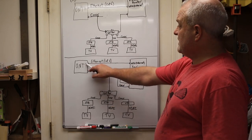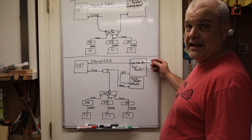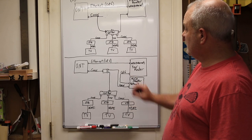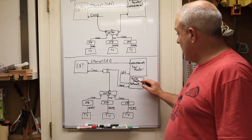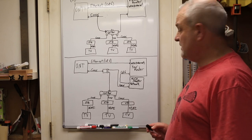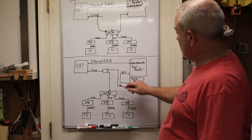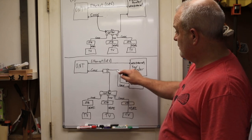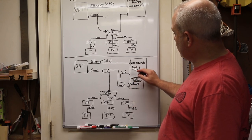Again, you have your ONT — you're going to have that ethernet wire go to the WAN or internet port on your own router, such as a Netgear or whatever kind of router you might have. Then you have the same coax coming out of that ONT going to the same splitter. You're going to have to buy what's called a MoCA adapter — I use the Motorola MoCA adapter, and I'll put the part number in the description. The MoCA adapter feeds the internet signal back into your coax network by connecting a Cat6 ethernet wire from any of the LAN ports on your router.